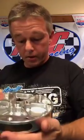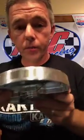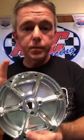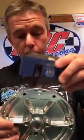Now, these differ a lot in the way you set up the timing. Like in some of my other videos, I'm going to go over the flywheel, putting it on, stuff like this. This is the ultralight PVL flywheel for the Honda or clone engines, the part number 6600. We have this also for the non-Hemi Predator, which would be a 6600P. So this is basically a modified 6602 that we make for the standard ignition, but this was PVL. And these flywheels have to be a specific size in order for this coil to work properly.